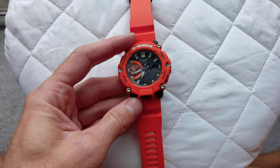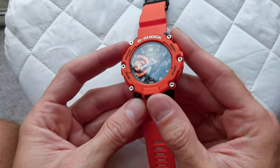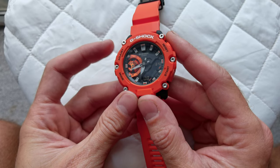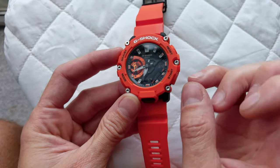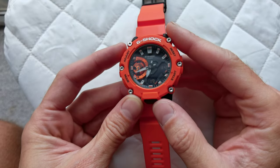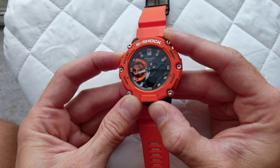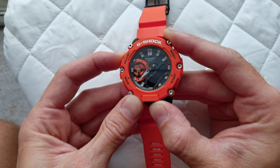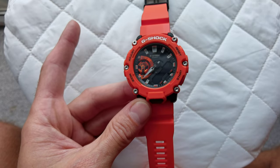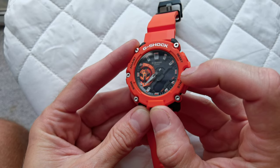You simply have to press the Adjust button at the top and hold it for roughly five seconds until you see 'SUB' written on the display. When that starts flickering, you release your finger off the Adjust button. So you press: it says 'SET,' then 'LONDON,' then 'SET' again, then 'SUB.' Once it gets to 'SUB,' just release your hand. Once you've done that, you're in the correct menu — SUB is flickering and you're in the correct mode for adjusting the analog hands.